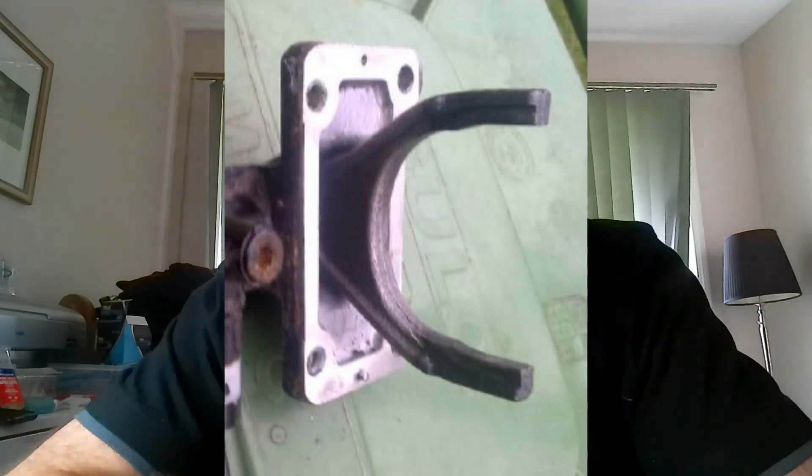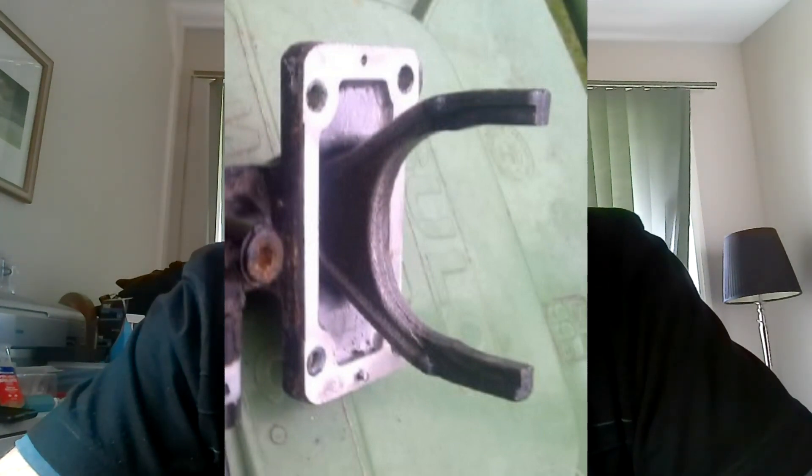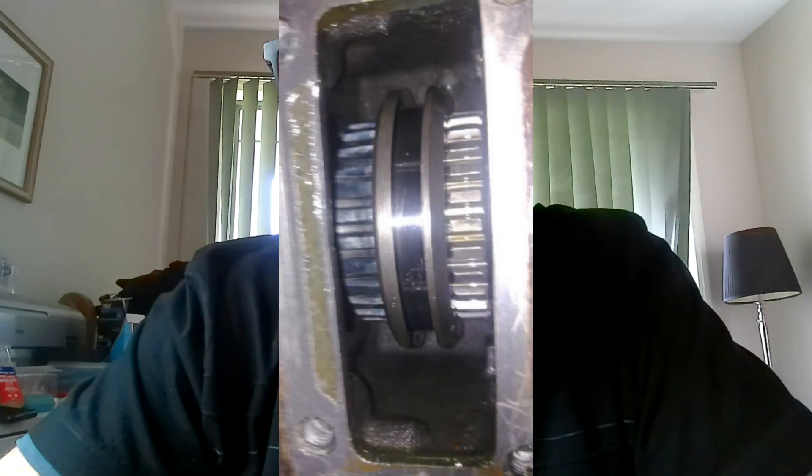If you look at the two pictures on the screen, the right-hand one shows the two gear wheels independent of each other — the drive shaft in the middle is separate. What that gear wheel does is join them together, making the drive shaft into one and allowing it to run. The gear wheel then reports back via another switch that it is in the correct place. The ECU now switches the flashing light to solid green. For any of this to work, you must have manual locking hubs set to lock and not set to free — auto locking hubs will automatically lock when four-wheel drive is set.